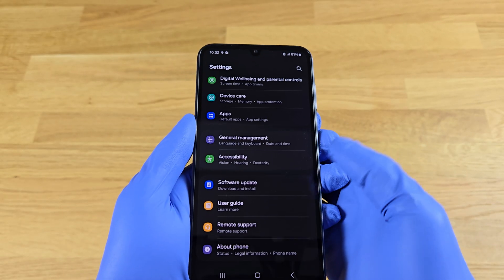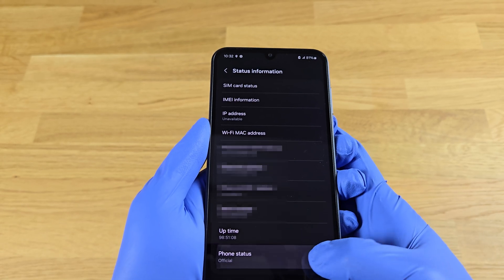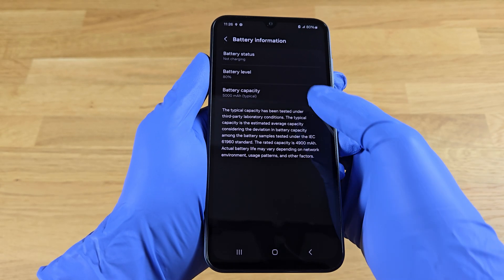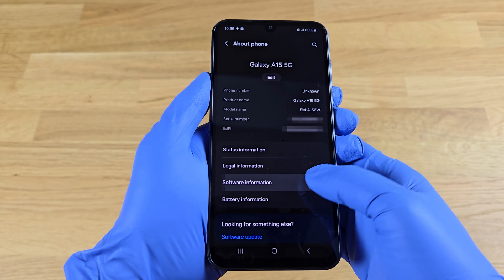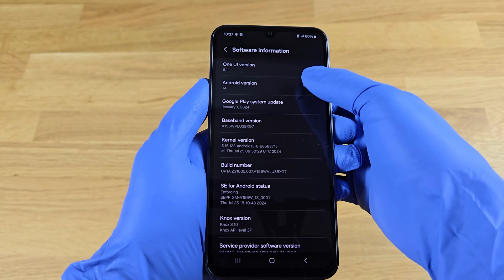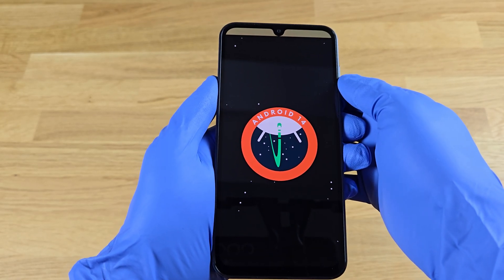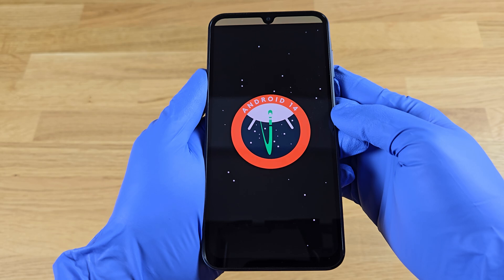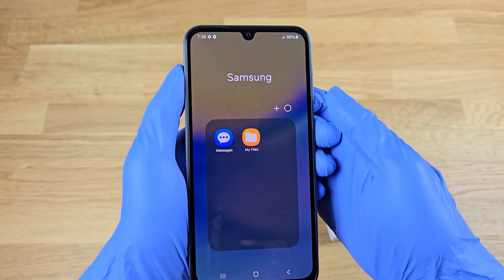Going back to the settings menu, under About Phone, tap Status Information. We can do further comparisons like the IMEI and serial number. We can also check that the phone status is official. Go back and hit Battery Information — look at the battery capacity and make sure it's the one currently rated for your device. Finally, tap Software Information and look for any inconsistencies. We can check the Android Easter egg — if it matches the current Android OS. To access this hidden Easter egg, tap the Android version option several times. This is the screen you'd get for Android 14, and it's different for every OS version. Lots of scammers can fake the OS version but most of the time forget about the unique Easter egg.